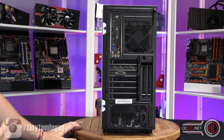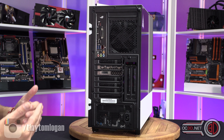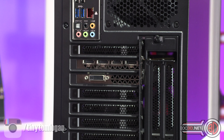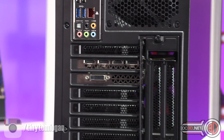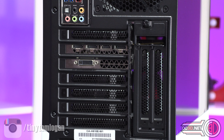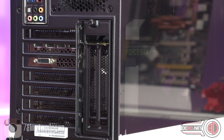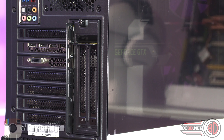When you get round the back, it feels cheap again. Single 120mm fan, no 140mm options, no adjustable options, nothing particularly special. You do have a couple of mounts to put a vertical GPU in if you'd like, but it's very close to the outside of the case — it's probably going to be too close for a lot of the larger cards. Most of the big-hitting graphics cards now are like 2.5 slot, and you're not going to be able to use that with this case. It's also just a normal 7-slot round the back, and the screws hang out around the back. To me, this feels like I'm reviewing one of the old H340 cases with a glass front panel on it.